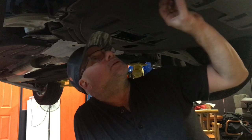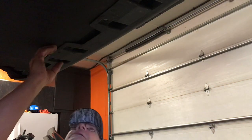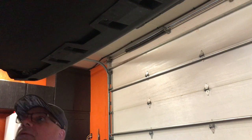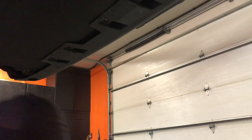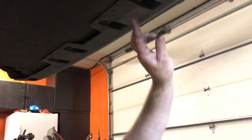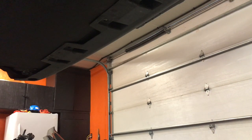I'm back. Now we're just going to do the body clip. These clips usually just take a couple of screwdrivers - I think there's actually a tool for it. The bumper skirt ones and everything are all the same. These are Torx T30 screws. Let me repeat that - they are T30 Torx screws.